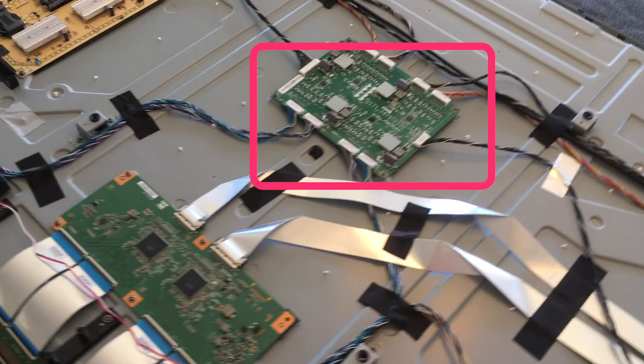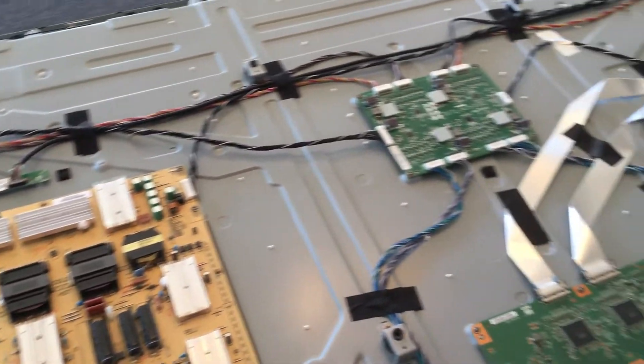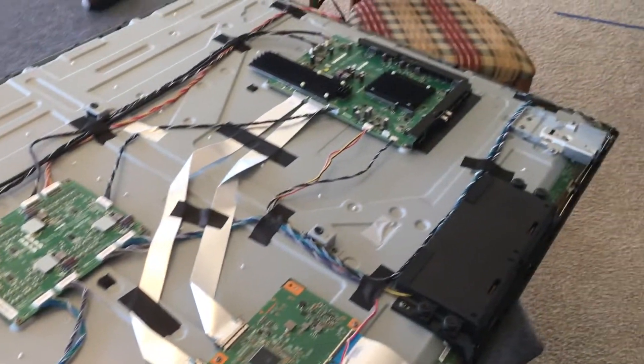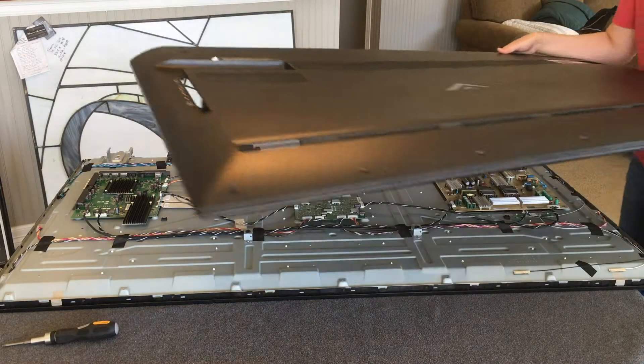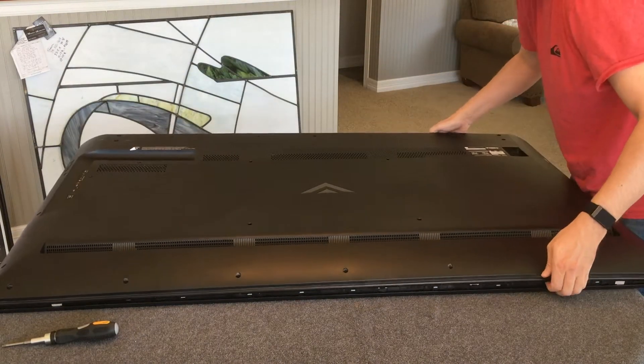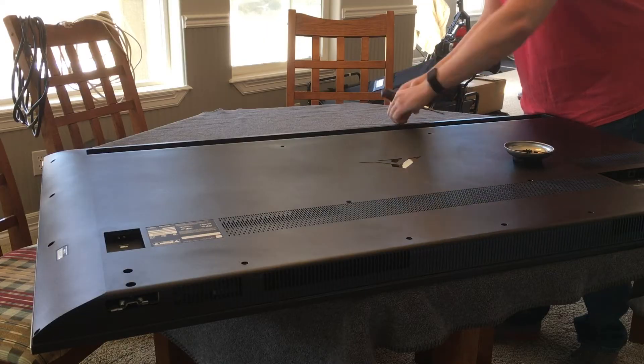You can see the different wires to the LED strips for the four quadrants going into it. It's held together with four screws and wires with easy pluggable connections. On the lower left is where you're going to find your part number — this is really important. Some have a 2B and some have a 2A. I went with 2B because that's what mine said. It's literally as simple as replacing that board: four screws, plugging the wires in, and buttoning this thing back up.